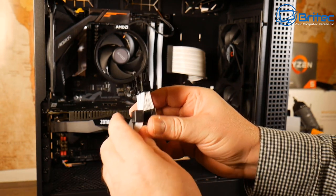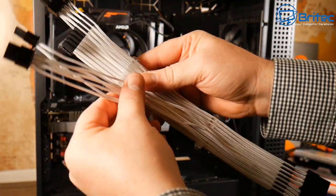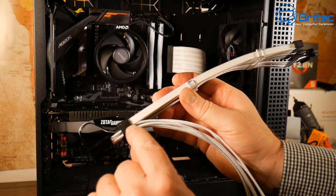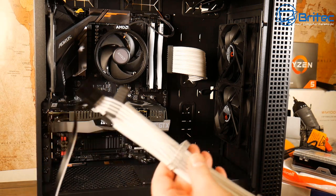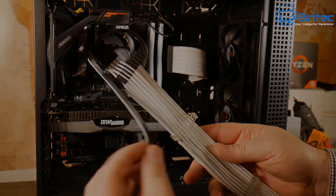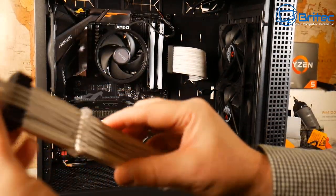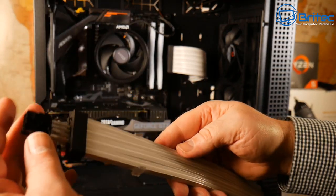There's a little plastic comb I managed to prise open to get access to the cables, which means I can pull one out. I've managed to pull that off and separate the other plastic comb. I just need to remove one cable, centralize the remaining one, and put it in the center. I've managed to make this into a single eight-pin connector — we'll still have all the RGB goodness but just using an eight-pin.